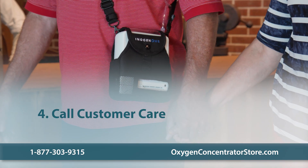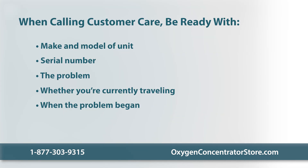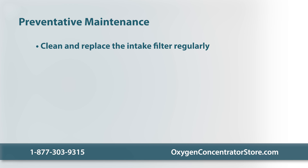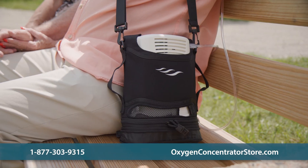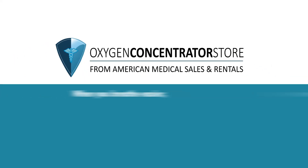If you're still having issues and need to contact customer care, you can generally find the phone number of your equipment provider on a sticker somewhere on the unit, or call the manufacturer's customer care number and be prepared with the information shown. To avoid issues with your oxygen concentrator, proper maintenance is critical. Clean the intake particle filter every two weeks and replace it every two years. The sieve bed and compressor may also need to be replaced. Some models have user-replaceable sieve beds so you don't have to send the unit to the repair center. Please contact us if you have any questions about maintenance, replacements, or oxygen concentrators. When you breathe easier, we breathe easier.